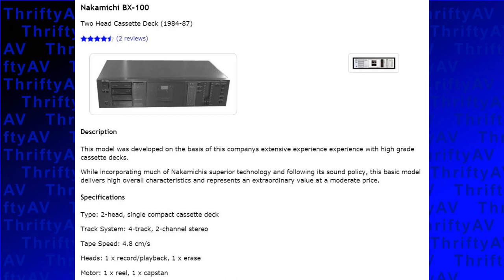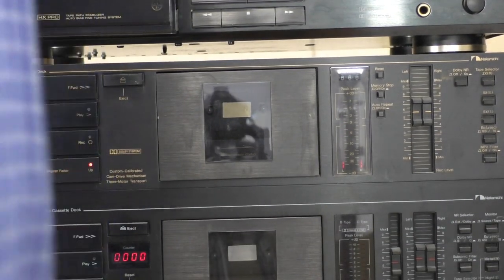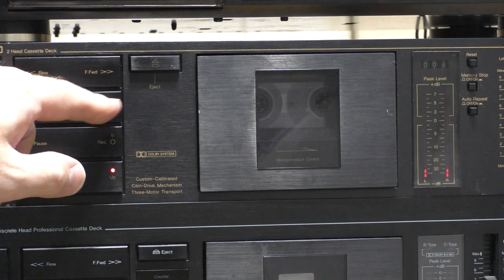The final tape deck I'm going to feature in this video is the Nakamichi BX100. This tape deck was manufactured in the mid to late 80s and is not one of their highest end units. It has two heads, a single capstan, and only features Dolby B noise reduction. That being said, it is the only cassette deck in my collection that I have performed a repair on. A worn idler tire prevented the Nakamichi from being able to take up tape slack during recording and playback. It also caused issues with fast forward and rewind functions. A few years back, I followed the step-by-step directions from ES Lab to repair this problem — a link to their site is in the description. I purchased two idler arm tires with the intent of installing the second one on my Nakamichi MR1, but my MR1's idler arm was gear driven, not tire driven. All it needed was a little touch of lubricant. Let's record Funky Element on my Nakamichi BX100 and see how it performs.